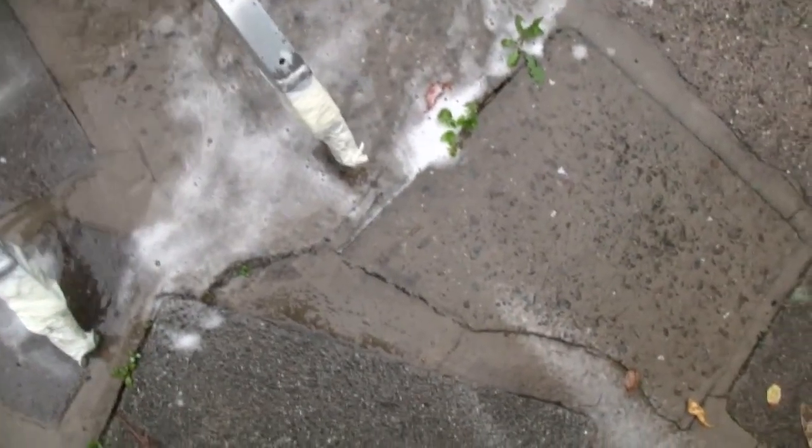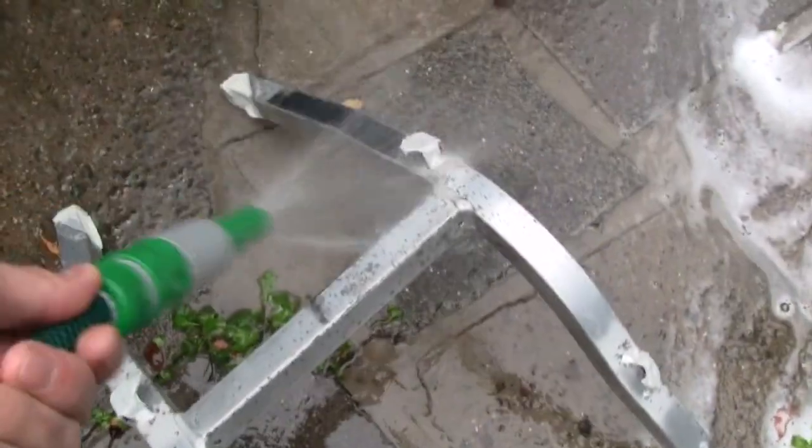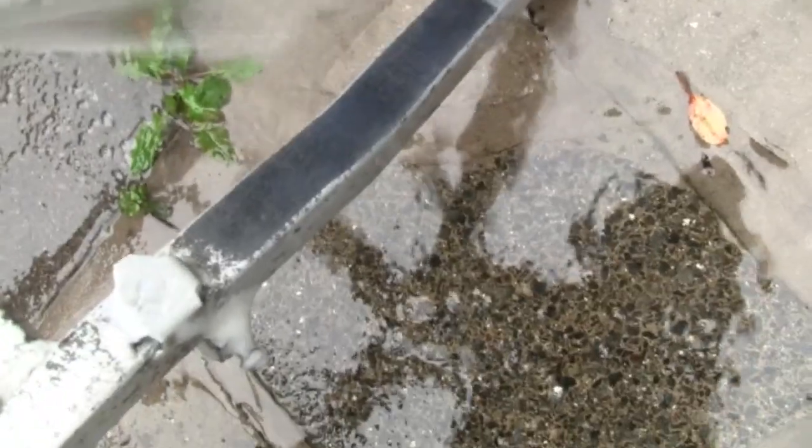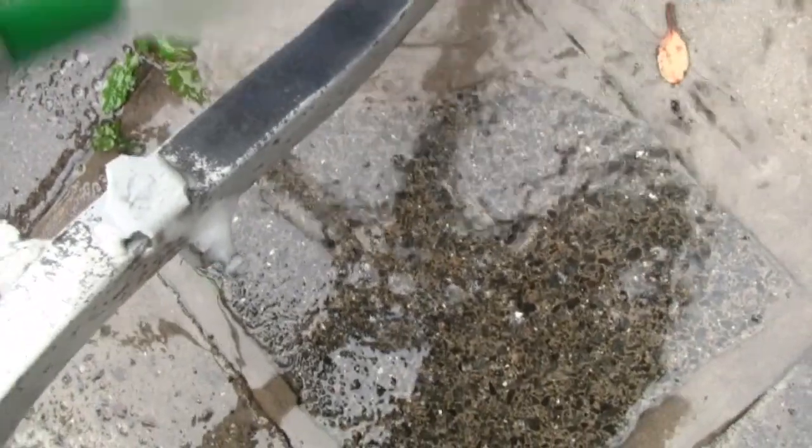So that's at 15 minutes now. I was feeling a bit gung-ho — it didn't look like it was bubbling radically or attacking the metal in any severe way, so now I'm just going to hose all that off. When you do this, you might find that your metal actually even goes black. You can see that polished bit I showed you before has been kind of attacked by the caustic and it's gone a bit black.